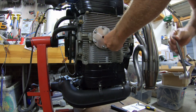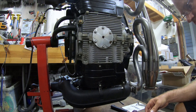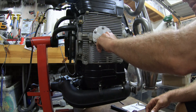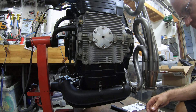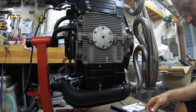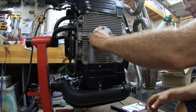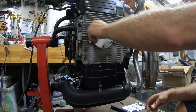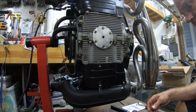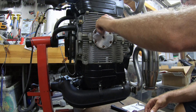Initially I didn't think I was gonna use a deep sump, but then I changed my mind. I had read various things saying if you're not gonna be putting g-forces on it where the oil goes to the side, you're probably okay without the deep sump. But then I read something that said anything over about a 1776 should have a deep sump.